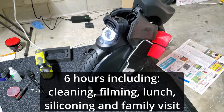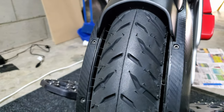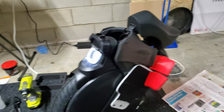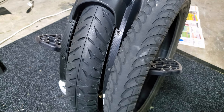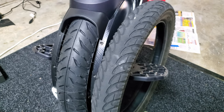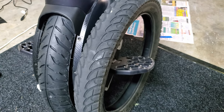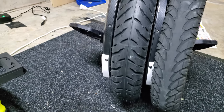I've just finished fitting the Michelin Pilot Street 2 — and there's your clearance. It spins really well and I haven't even ridden it yet. Here's the original beside it for comparison. Remember I've got it in the front wheel orientation — you can run it in the rear, but from what I read you want the front orientation because on motorcycles the front tyre parts the water and performs better under braking, and for EUCs braking is the greater force.